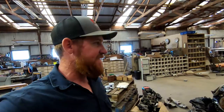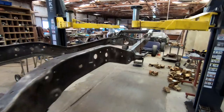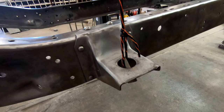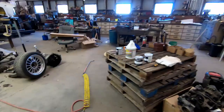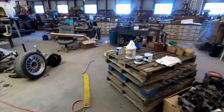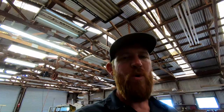Okay, it's actually the next day. I got everything washed and now you can see it is hanging up here — just hanging from the left with these washers. That way there's a small amount of frame that's not going to get painted because of the washers, and I can just do that afterwards. Yesterday we got everything washed, but after you wash it, don't think that you're done. I got the subframe done as well. Just because you washed it doesn't mean it's going to be perfectly clean. Once you bring it back in, wipe everything down again with some type of acetone or grease remover. I already did that, so I think I am pretty much ready to get into painting.